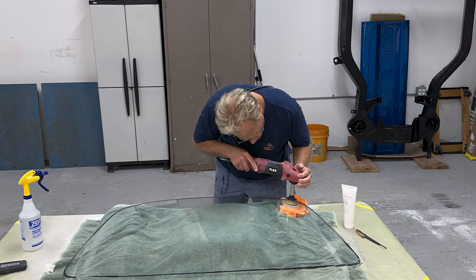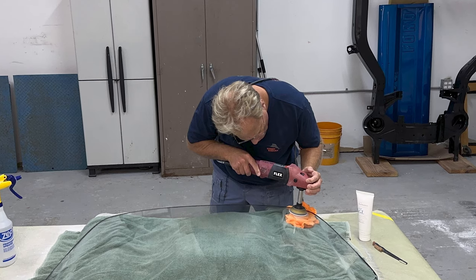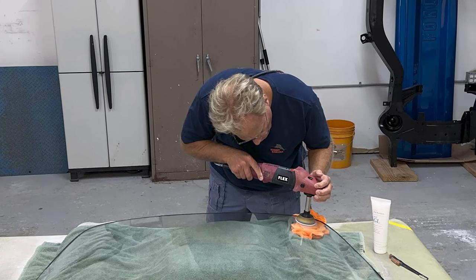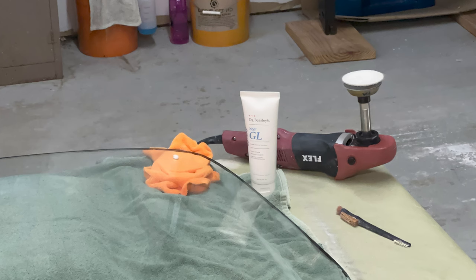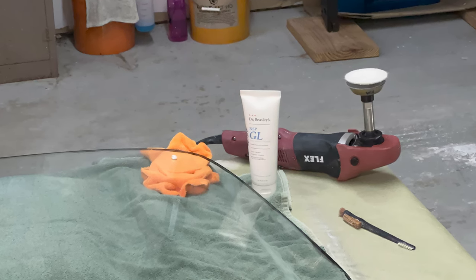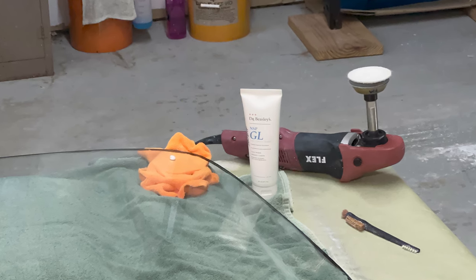And basically it's just harder to sand with a big 5-inch or say 6-inch disc around the edges compared to just sanding out in the middle of the glass. That's pretty easy, just run the buffer over the middle. As you get towards the edges, you gotta start being more careful because you don't want the pad to grab the edge and throw the glass off the window, off the workbench. So you just gotta be more careful, and being more careful, sometimes that ends up leaving some of the smaller scratches that you didn't get out.